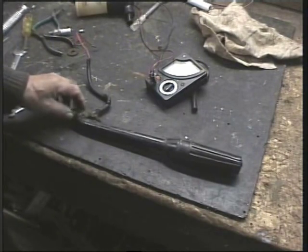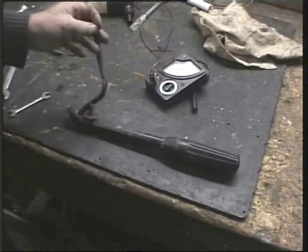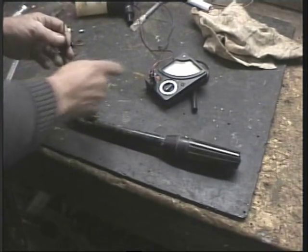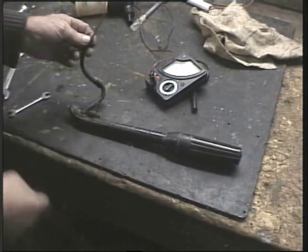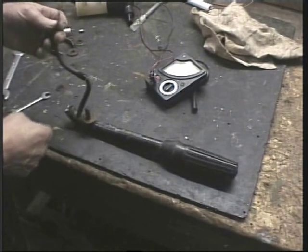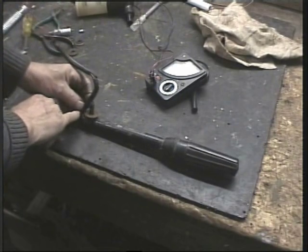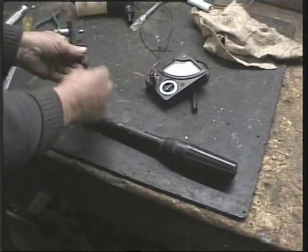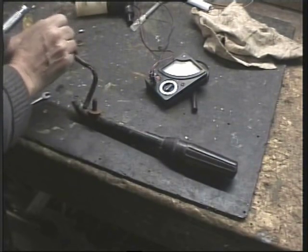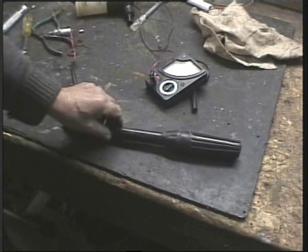Anyway, I've taken the tiller arm off with the stop button on the end. We've only got 2 leads to it, so it can only be a push-to-make switch. And with the meter on continuity, it's no longer a short there. So it must be the engine end. Anyway, it's an opportunity to put some tape round where it goes into the metal, and to put some shielding on here, which is quite close to the exhaust pipe, and clean up these connections. But the mystery continues, folks.